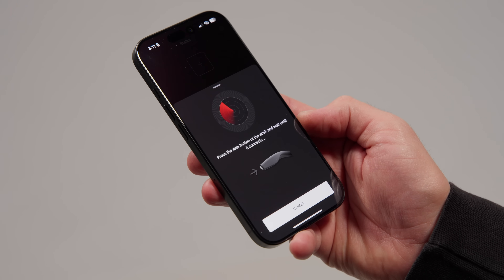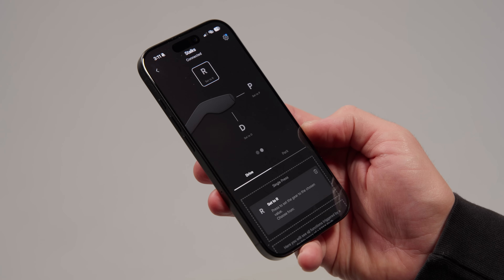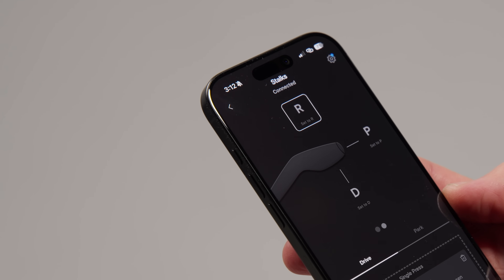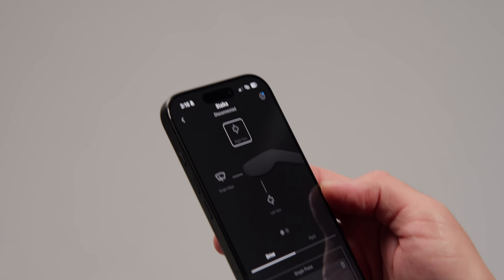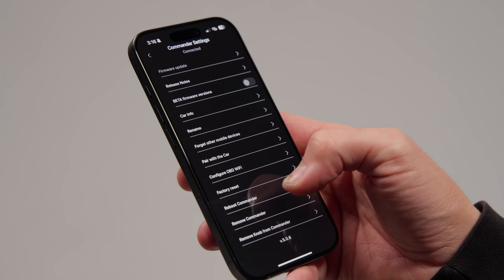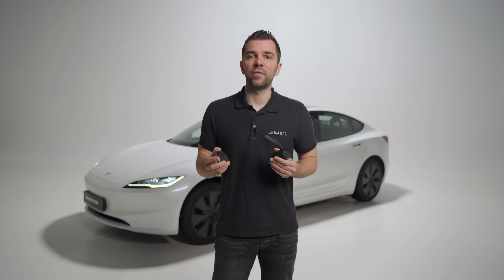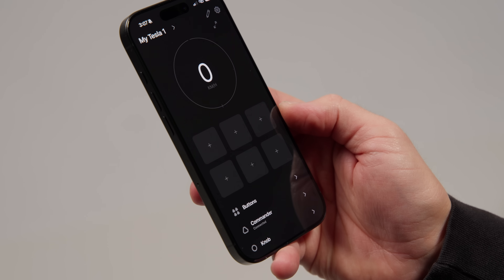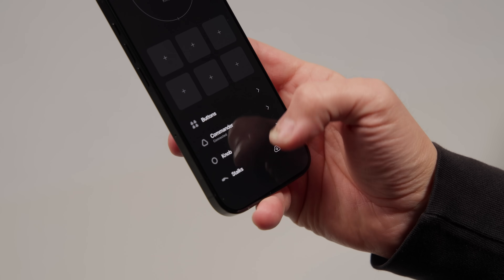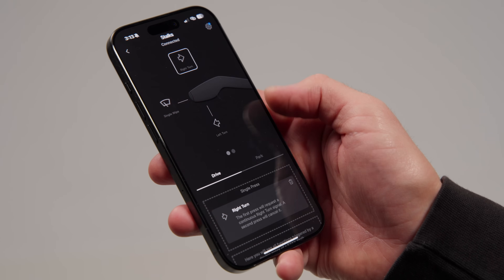After the update is done, it's time to pair your new stalks from the tab at the bottom of the home screen. The step is similar to pairing the commander — once you see the pairing message, press the side button of the stalk. Connect your second stalk by swiping left on the screen and repeating the same process. Once the stalks are paired to the app, they should automatically connect to the commander. If they are not connecting, doing a factory reset or holding the side button for 15 seconds might help. You can also contact the support team via the email in the description below.